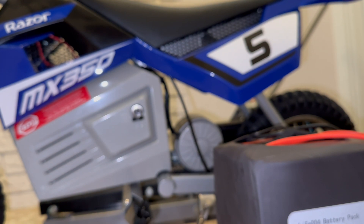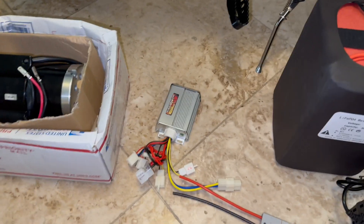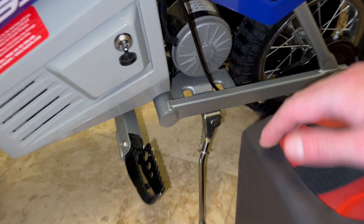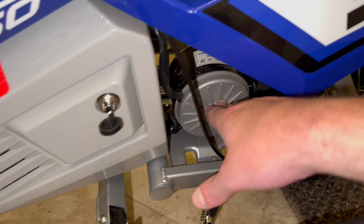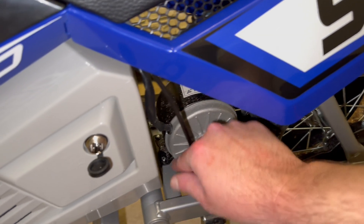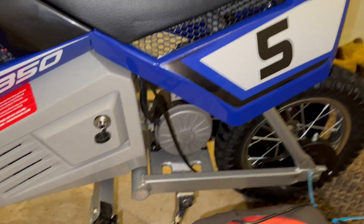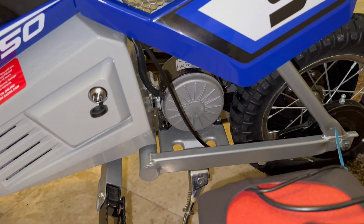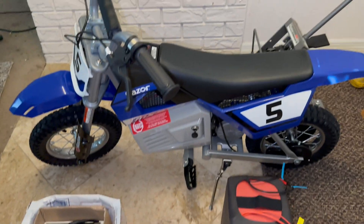That's it, pretty easy. He's not going to be overvolting it — it's just going to be 48 volt brushed. Since this motor is not going to fit flat, in my older videos I was putting it at an angle without screwing in those two screws, but since I'm doing this for somebody else I've switched to using half-inch spacers to lift it up just enough to clear, and I use all four screws. It's just much better than putting it on a tilt. We'll drill those holes, put the spacers in with the new motor, wire up the controller, wire up the battery, put the throttle on, and we'll be good to go.